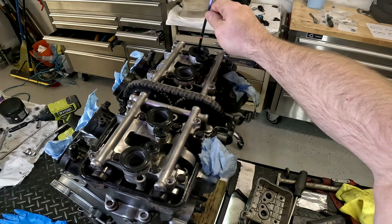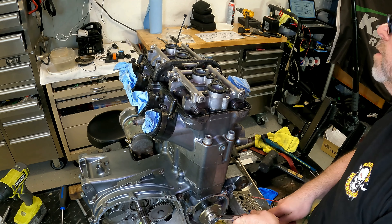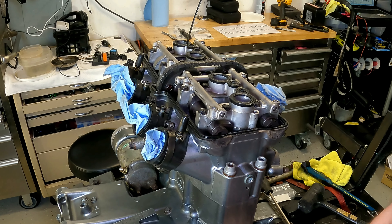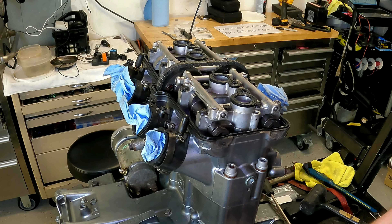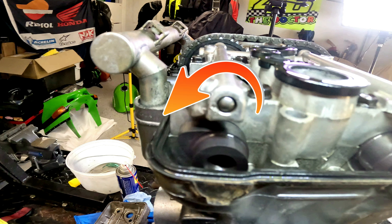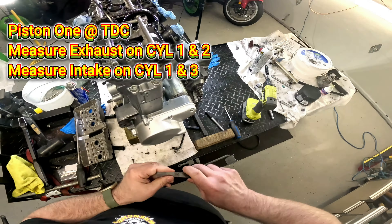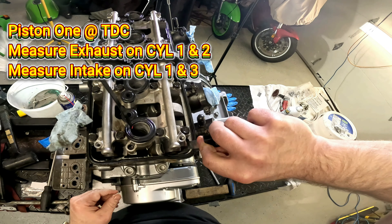When you're ready to align the timing marks on the camshaft, rotate the crankshaft clockwise only from the right side of the engine. If you were working from the left side, you'd be rotating the engine counterclockwise. It's important to rotate the engine in the direction it normally moves when running to keep proper tension on the cam chains and camshafts. With the bike at top dead center on the number one piston, the camshafts should be aligned with their respective marks along the top of the cylinder head. The cam lobes on cylinder number one are also going to be about 90 degrees from the valves, with the exhaust cam coming down towards the valves as the engine crankshaft continues to rotate. With all this confirmed, I can now check the valve clearances on the exhaust of pistons one and two, plus the intake valves on pistons one and three.